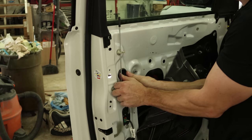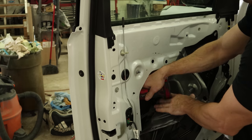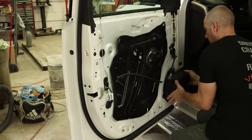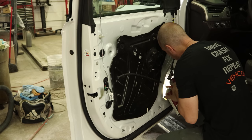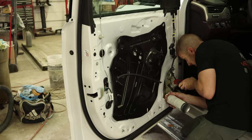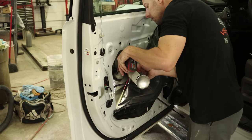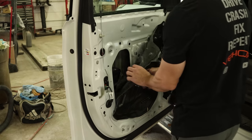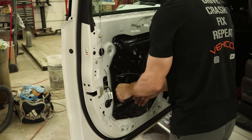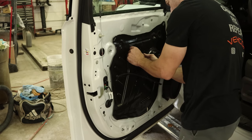I don't think you want to watch the same process all over again, but it's in there now. So put our caps back on, get our flashlight out of there. Pull the grab handle bracket off, pull the front speaker off, and we'll put a little cavity wax down in the bottom seam — a process almost as predictable around here as screaming when you back a truck off the trailer. Once we have a good coating of wax across the bottom seam, we can put our water barrier back up, push it back on, then snap our speaker in and bolt it in. Put our grab handle bracket on and tighten it up.